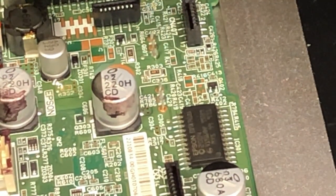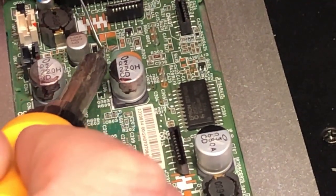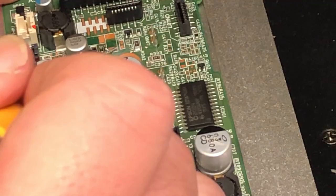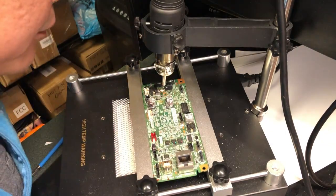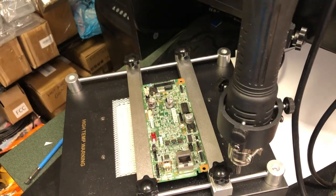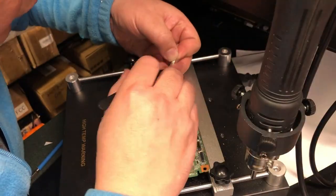The old-fashioned soldering iron way: put more solder on it. It's not intuitive, but your goal is to heat up both sides of the fuse — basically overpower it with solder and then you can remove it. Some people do not replace the F1 fuse and just short the fuse. You may be okay, but keep in mind — next time when your board needs to blow the fuse it cannot, and it will probably blow a small transistor instead, which will take ages to find. I suggest just put in a couple bucks and replace the fuse.